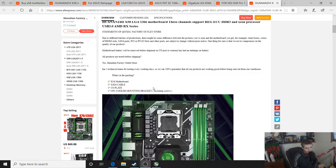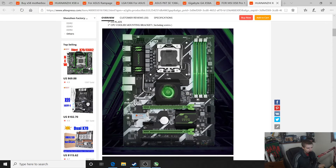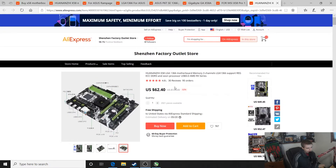So if you're going to be using ECC memory you have to go X55 or X56. I haven't tested whether the E-series or W55-series CPUs work with ECC memory yet, but I probably will in the future. This is not a bad board for the price, but there are other options on AliExpress. Let me show you something I just learned — at $62 for just this board, buying the board, memory, and CPU together costs more than what I'm about to show you.